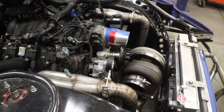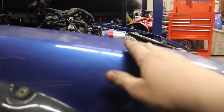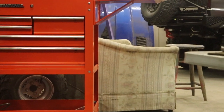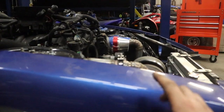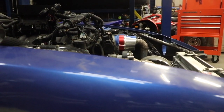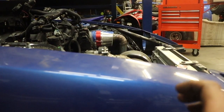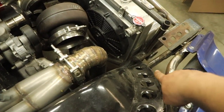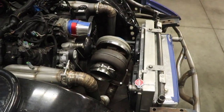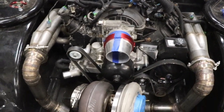I'm test fitting the four-inch clamp on the throttle body, and the four-inch to three-and-a-half inch reducer is on there with tape for now. I want to make sure it'll fit under the hood slope - the hood does have a little cowl over there. We'll have to tack it and then put the hood back on and test fit. Because the throttle body angles upward it'll be a little tough - I'll start cutting and angling it down, running it through to the intercooler.